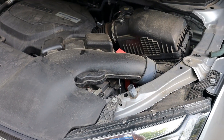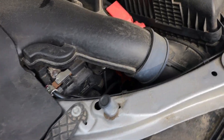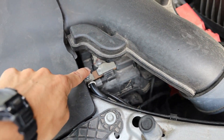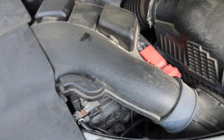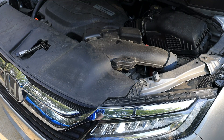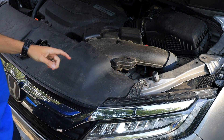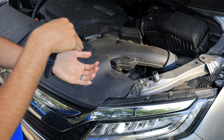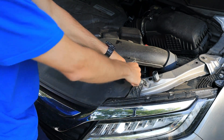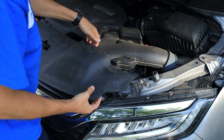On these Odysseys the battery is located on the driver's side. An easy way to tell is by this big bright red positive cap right here, and obviously the negative is right over here. Don't let this whole thing right here fool you. I'm going to show you the quick and easy way to disassemble all this to get to your battery. First, we're going to have to remove this plastic radiator shroud right here. There's no screws involved — all they are are just plastic push pins. You're going to want to lift straight up, don't try to rip sideways. See how easy that was, just pop them straight up.